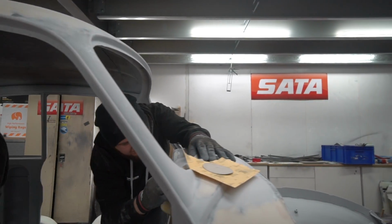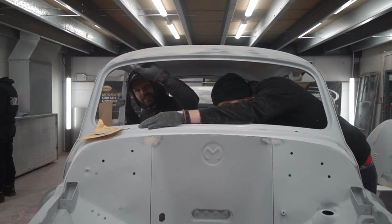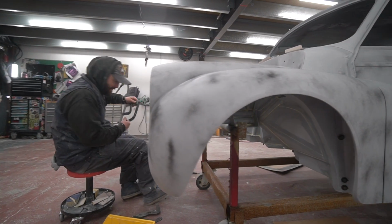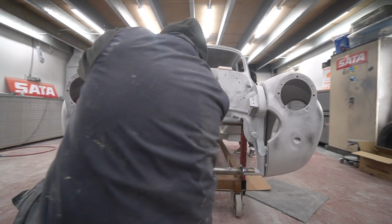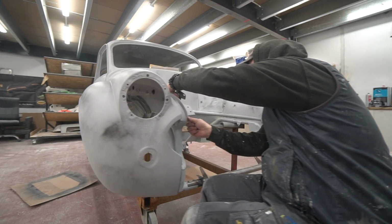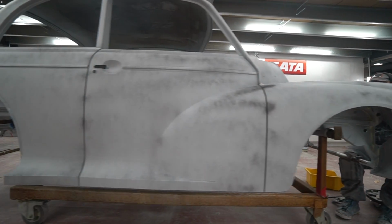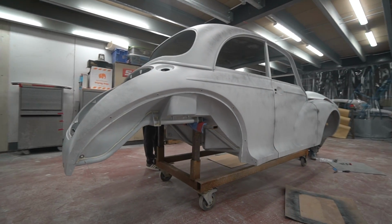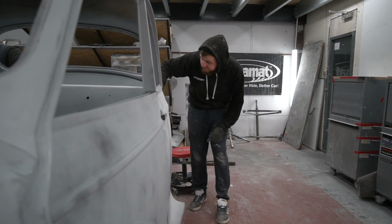Earlier in the week, we had a little bit of an issue getting hold of some sprayable polyester. However, we've now got some, and the car is now coated with the sprayed polyester, and Gaz and Steve are now getting through the blocking process on that. They're not there yet, but they're getting slowly through that. I think we're going to need some more polyester on it, another build and another blocking session. But they're getting through it now, finding the bits we've missed.